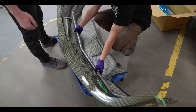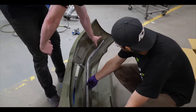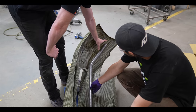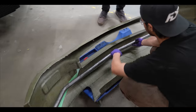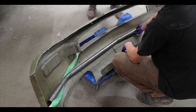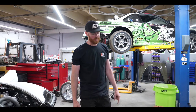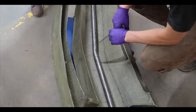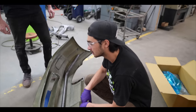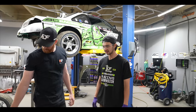It doesn't fit — the end needs to be way shorter. We're thinking of cutting about six inches off so it doesn't go into the tire. It'll touch here but not there, and touching the corners is the most important thing. We'll start by taking four inches off each end. What we really need to do is put the bumper on the car and hold it in position — probably using vise grips to clamp it somewhere.